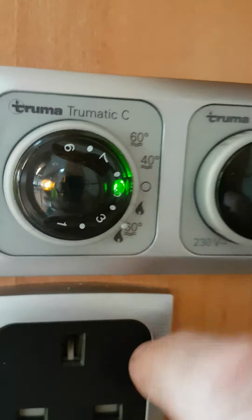If you're not near the van, or you've left the van, you've gone away, and it's got very frosty, that'll drop down and protect the heater itself. So when you come back, then that valve will be down and the heater will actually be empty. So if you turn on your hot tap at that stage, you'll probably be getting water coming out from underneath the van because you've opened the system. So you'll have to come back here and pull that back up again.